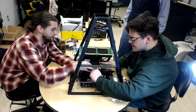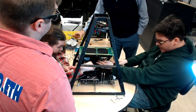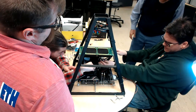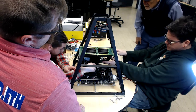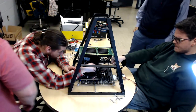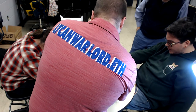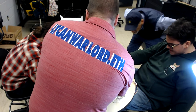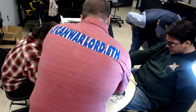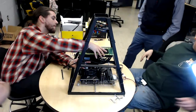They're big. Like tubes like this. Yeah, like that. Does it have an HDMI? No. Could it be fit? No. The card's going to touch the power supply. Okay. That looks good, though, I think. Like that. I think it looks great. It's just not going to work. So unless you guys have a spare graphics card that's not this thing. If I could get my brother to answer me. Yeah, it's another 2 inches we need. And if you go under, you're going to be pinching it against the ring. You're already going to be hitting the power supply. It's already not going to work.